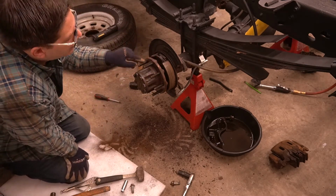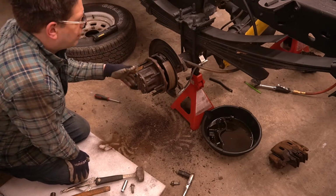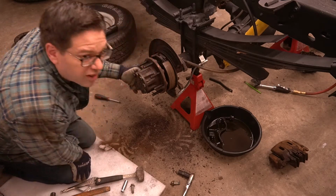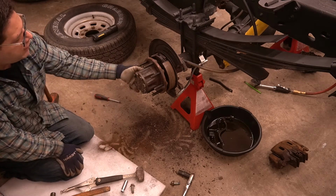So what you're gonna wanna do when you get all that done is inspect your parking brake mechanism, your emergency brake. Make sure the shoes aren't worn, make sure that everything isn't too crusty and rusty, that the springs aren't broken. So you can just kind of peek around in there. And I'm looking on ours, I'm gonna give it a thumbs up. We're looking pretty good.